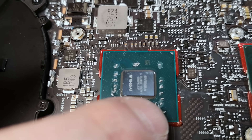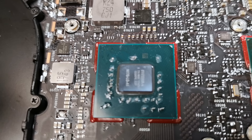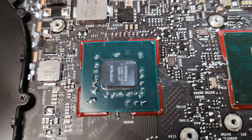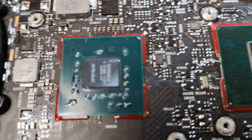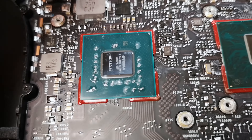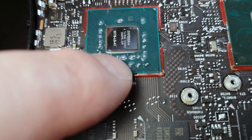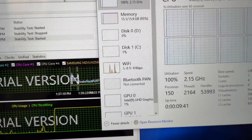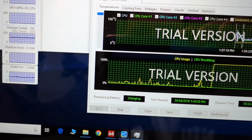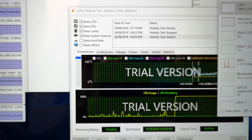At the end of the day, when I took it off after checking, I saw that the heatsink was not copper either. So obviously, liquid metal — I can't do it with this laptop. But when I did do it and ran the CPU, it went from the low 70s to the low 50s under load, and that was with the fan running really low. You could not even hear the fan. You would not even know this laptop was under load. I'm amazed — this is running flat stick at 100% and listen for the fans.